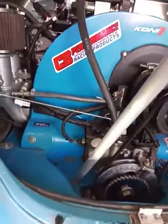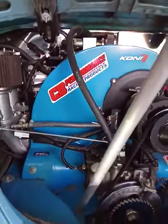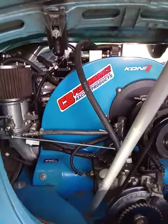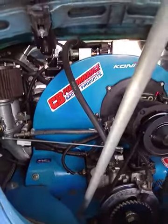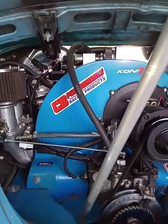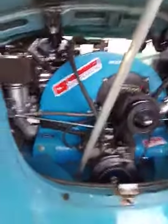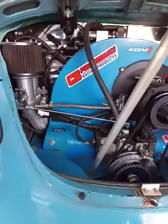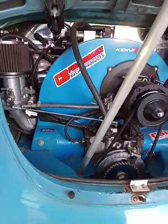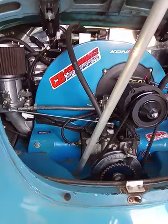Cons — my list of cons is actually fairly large. Starting with the wiring loom: previously I ran the Magnatec crank trigger and the wiring loom came complete with all wires needed for all options. My wiring loom came with enough supply to run the system with everything stock, but if you want anything extra — like the general purpose outputs (GPOs), the extra exhaust gas lambda sensors — you have to fit it yourself. That assumes you know how to plug into the special fancy plugs that come with the system. Items like my oil cooler fan I've had to run off my fuel pump relay, so anytime the fuel pump runs the oil cooler fan runs, which isn't exactly ideal. You should be able to set the temperature at which it turns on and off.